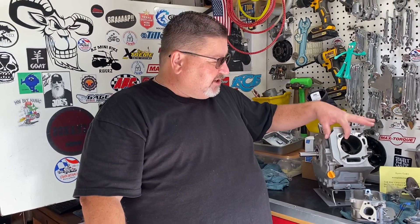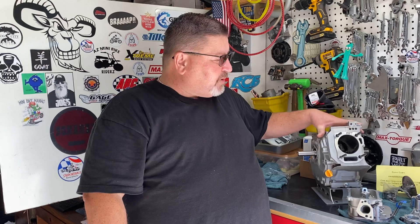What that's indicating is this engine, with the stock rod and the stock piston, the piston was 57 thousandths down in the cylinder when it's brand new. I don't want that, because compression is going to be our friend in these engines to help us make power. So what I've done is I bought the plus-20 clone rod and the 570 pin height piston.